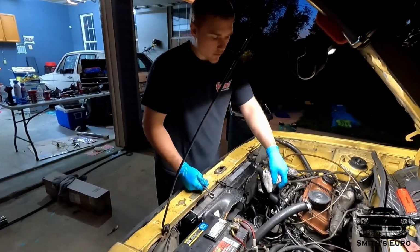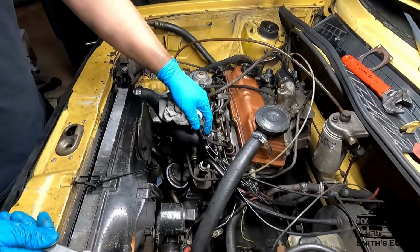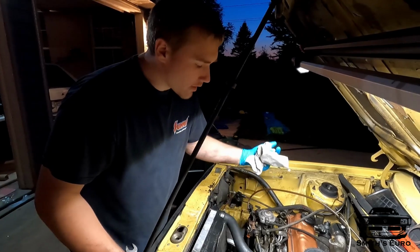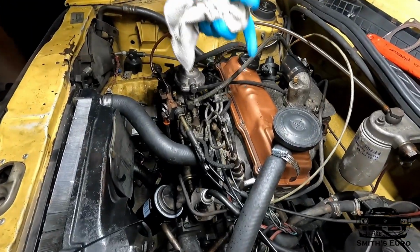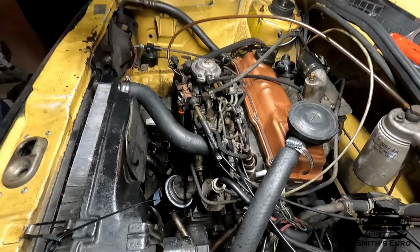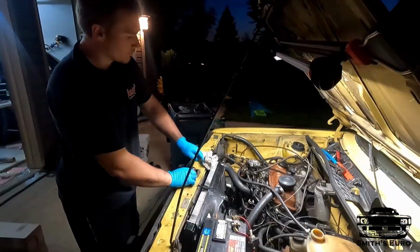So we're going to try to crank it over, so you got to leave all these fuel lines loose on the injector. So then as it's cranking, when fuel squirts out of it, you know fuel's getting up to the injector. I've already primed the system by just putting a vacuum pump on the end of the return hose and then putting the return hose back on. So now she should just crank it over and then should be okay. So go ahead and just crank it, James.